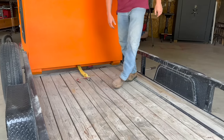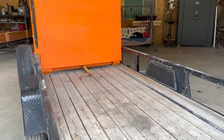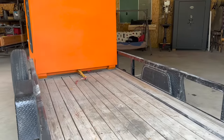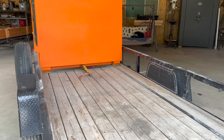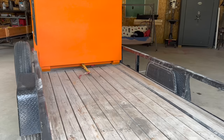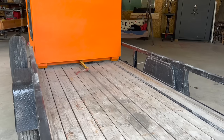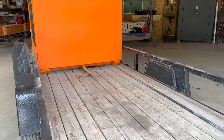All right. The edges, if you can see the far corner where Monica's showing right here, those skids, I have a 45 degree angle cut in them. So what I'll be able to do is as I hit the winch, that should climb right onto the trailer. Now that I'm on the trailer, I want to go get my jack out of the way before I continue.